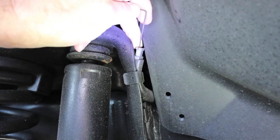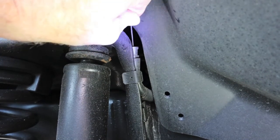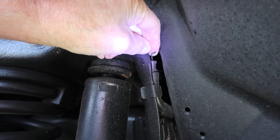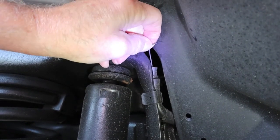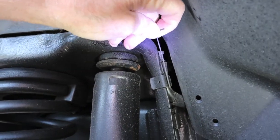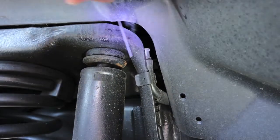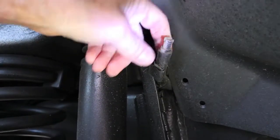This is a 50 thousandths inch hex wrench, and it will go clear down to the curve — it just lacks about a quarter inch of going to the curve. So we'll pull it up and put our thumb there. It's a long one, and you can see that it did in fact go clear down to the bend in the hose. I'm going to reroute this. The vent will just unclip, and there are plenty of better places to mount it.